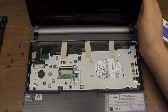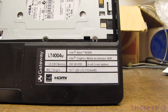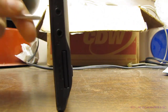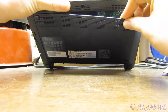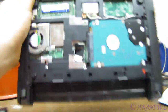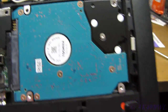A magnetic screwdriver makes it work wonders for doing that. As you're looking at this from the front, come down here right by the hard drive and you'll see the door release. You'll probably want to try to push that with a flat blade screwdriver — watch, because that is part of the door. Just keep on pulling it. Don't worry too much because you're not likely to break anything. Now you have access to the RAM, your wireless card — which looks like a micro mini PCI Express — and your hard drive. Upgrade them at will.